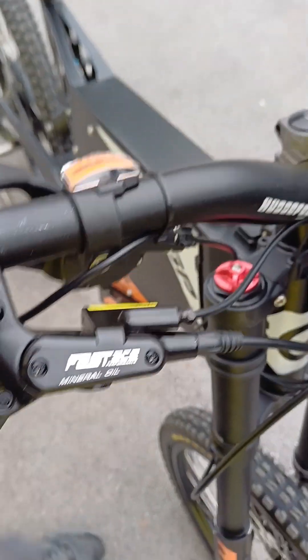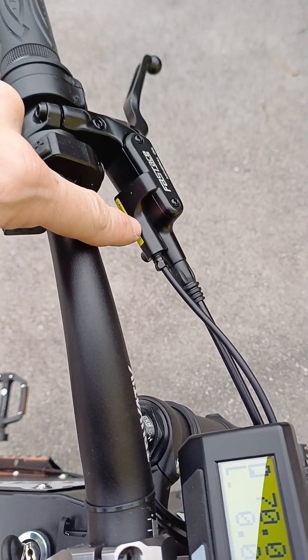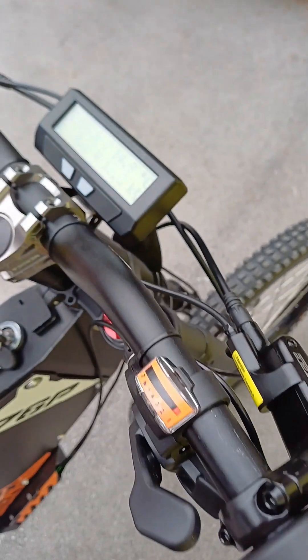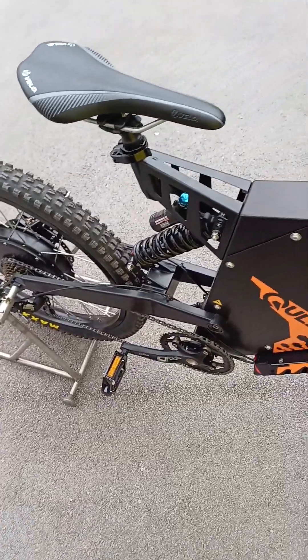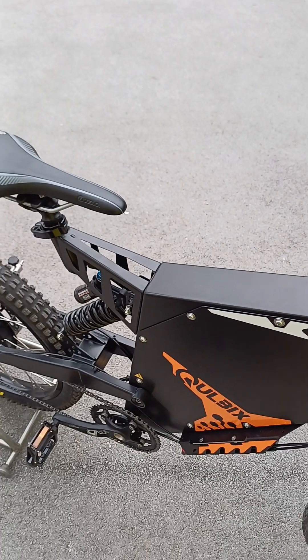There are also two important safety features. There are switches inside the brakes — here and here. So if the motor is turning and you are pedaling and you want to brake, at that moment the brake disengages the motor. It's a safety feature so the motor stops turning when you brake.